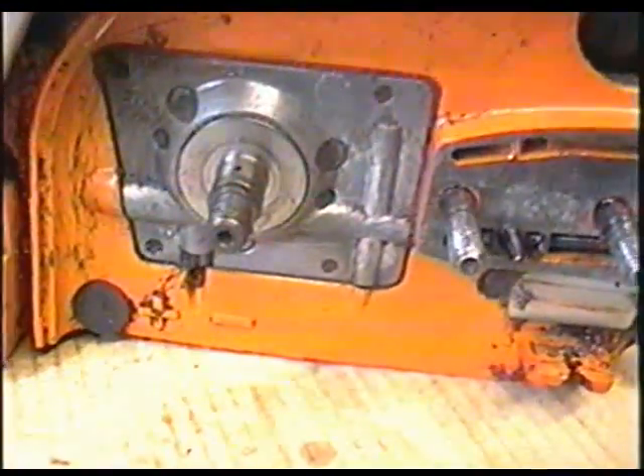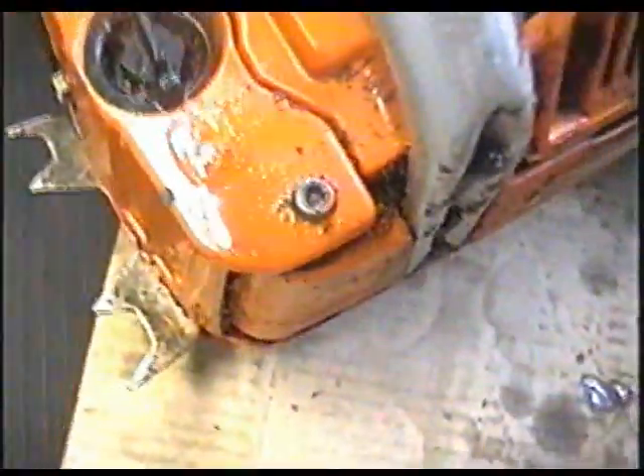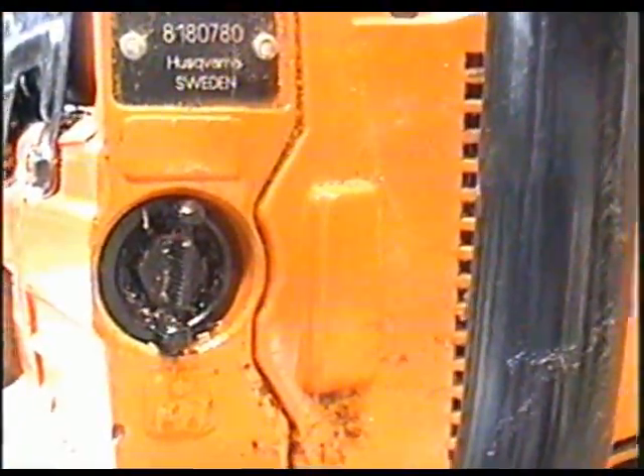It's been sitting for approximately four hours and as you can see there's a puddle of oil on the side of the oil cap. If you look on the side of the bar and clutch it's perfectly dry. So the oil is coming from that side. I can see that the oil ran down the cap all the way down. Hopefully that's all that's wrong with it, so I'm going to take the cap off and see if there's an o-ring that goes there.